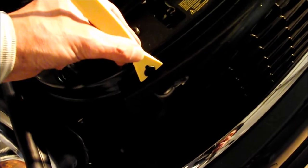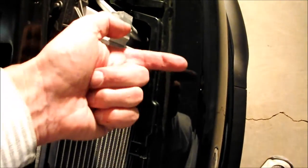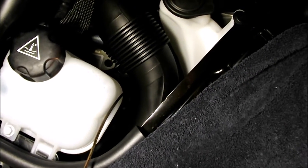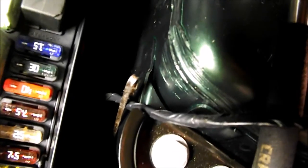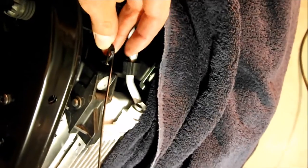You have to remove the four pins along the top of the radiator grill — I used this tool to pry those out. The radiator cover comes out at the bottom this way, so you need to pull it forward gently; there are four clips that hold it in place. You're supposed to run the wire along the wiring harness in the engine compartment, but I had trouble doing that so I resorted to fish tape again. For the driver's side I stuck fish tape through this hole and hooked on the wire to pull it through.